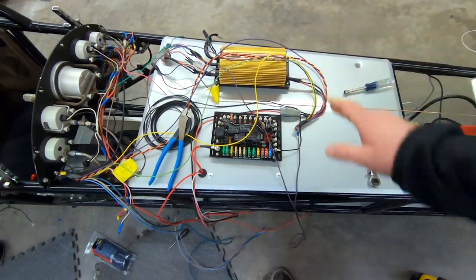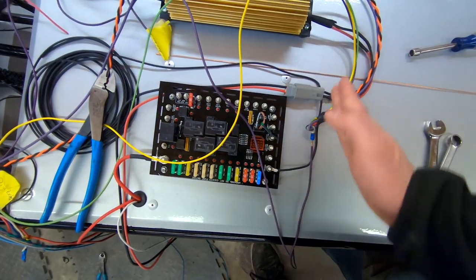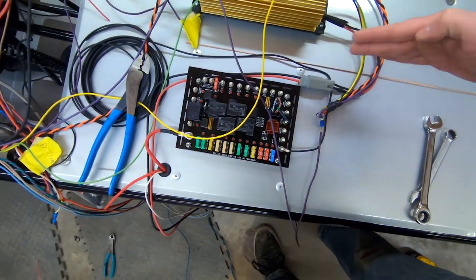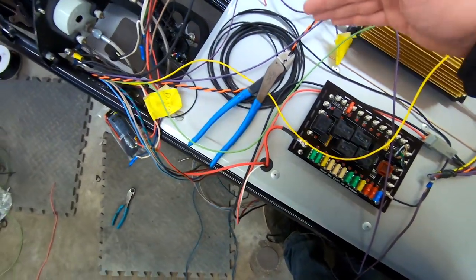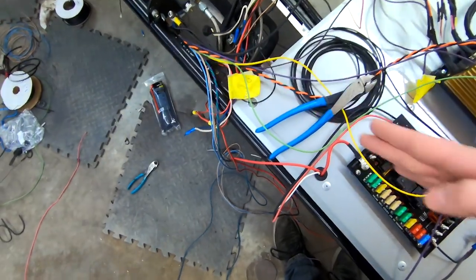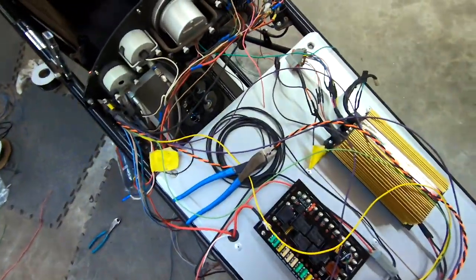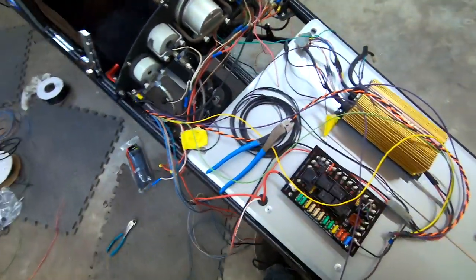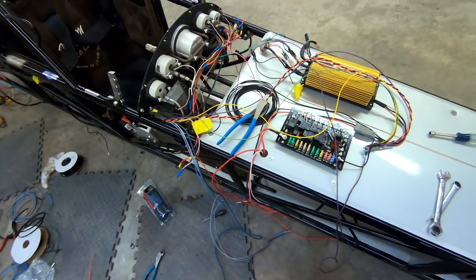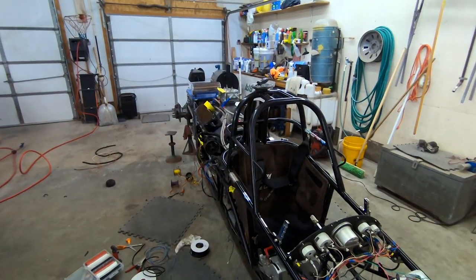We're gonna try that out, see if we can have all the wires join a big loom here, and then it's gonna turn and all of these wires will be joining the loom. These wires will come around, we'll have a run down the middle. And then of course everything will probably square up and go this way because a lot of stuff heads to the back of the car. All of the grounds are headed here and all the hots are headed over here. So as you can see, we've got some spaghetti that we're dealing with today, but hopefully by the end of the day, this looks a little cleaner.